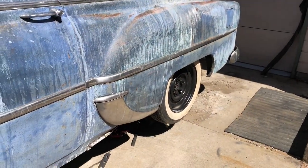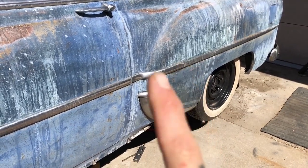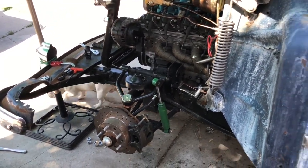But I have the rear tires on. I welded on a tab for the rear brake line, and that rear end's done except for putting in the bags. Same thing up front — I have to put in the bags.